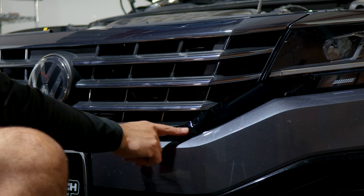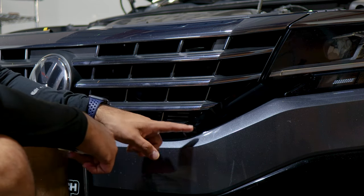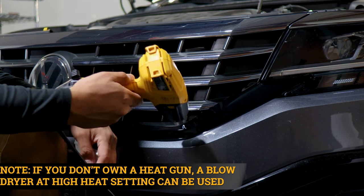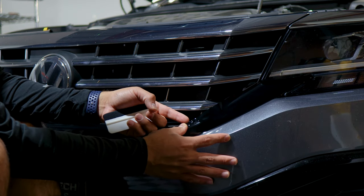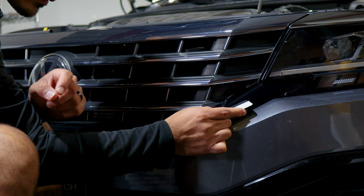For the curved area, we're going to apply a little bit of heat to help remove any fingers. Apply heat around the curved area to release the tension on the film so we don't crease it. Grab your heat gun and apply heat around the curve. Let the film cool down, then lift it and with your fingers slowly — little by little — help it tack down. Then use your squeegee to finish it off.